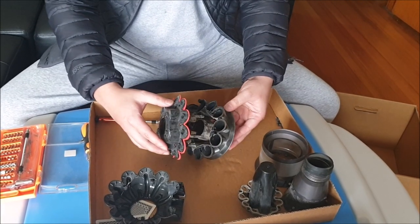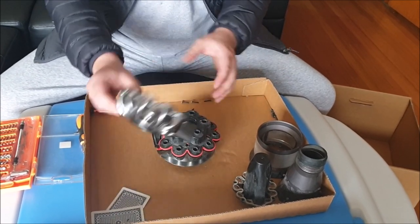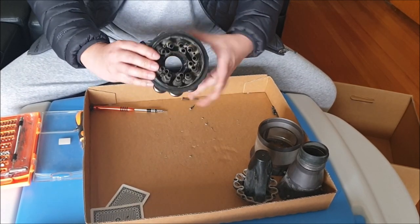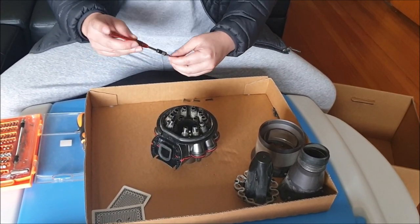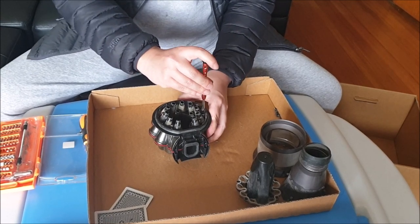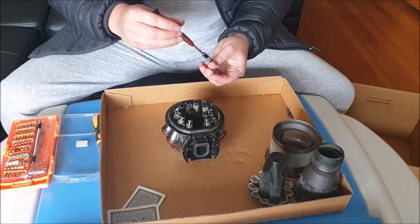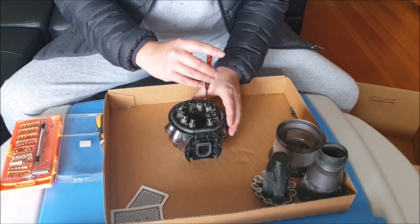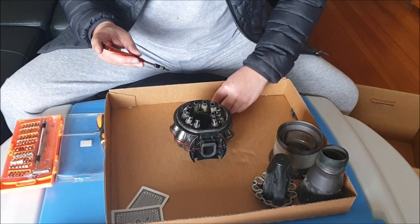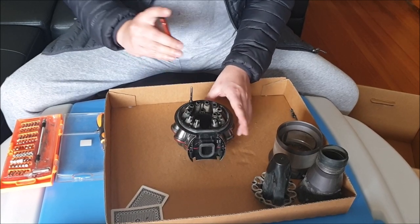After this, we need to combine these two pieces together. Remember to align your screw holes and remember to put the back at the back. You can then put the head back on — also remember to align the back with the back. Squish it together with your hand, and if it feels squished, it's most likely correct. Put your four screws back in the center. This part requires a longer-reach Torx screwdriver. I inserted a screw into my magnetic tip to make it stick out longer, and that seems to be enough.